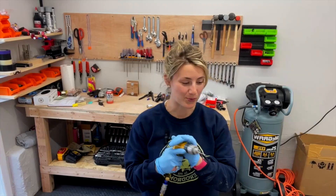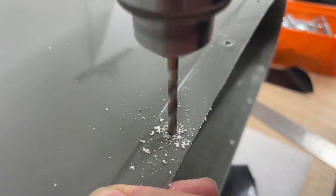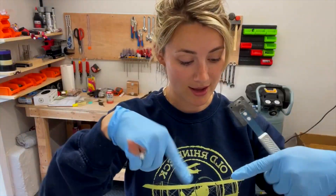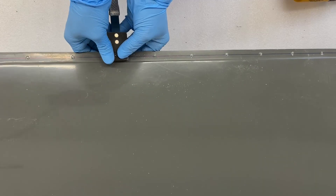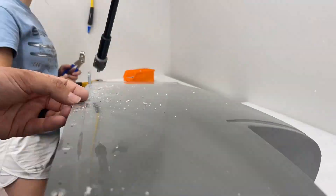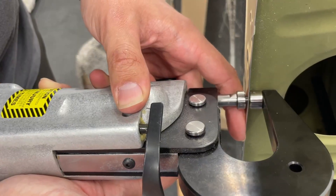So we are working on our wingtips and we've already drilled them out to the proper size, but the fun part is the little nut plate jig — I've been so excited to use it. I'll point the camera down and show you how to use it. There are multiple ways to attach the wingtips to the wing, from using a piano hinge to riveting it on permanently. We wanted the option to remove the wingtips as needed and chose the nut plate and screw method. This involves drilling and countersinking the fiberglass before riveting the nut plates onto the inside. We also needed to drill and dimple the wing skins to accept the screws.